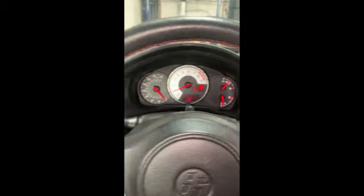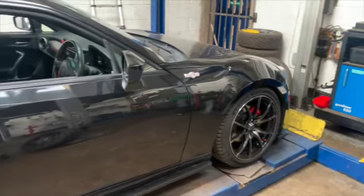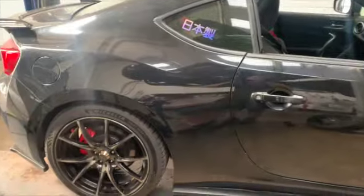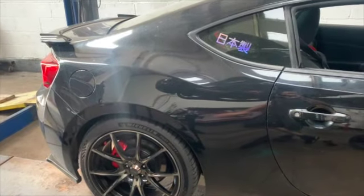We've been through a little road test to settle the suspension down. Now it's time for alignment. So that's without any adjustments — not bad. Wheel alignment is all good and set. We have gone for 2.1 negative on the front and 1.4 on the rear, and we've gone zero toe all the way around. Now we're going to take it for a little road test.